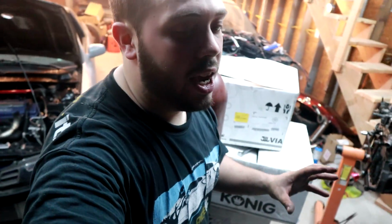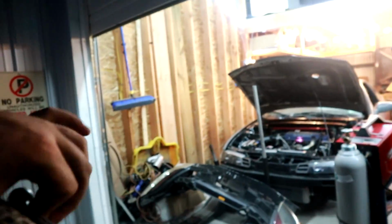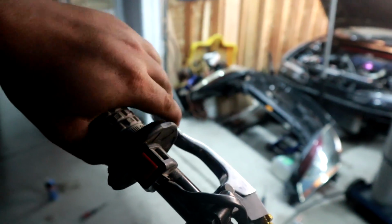Okay, so the levers don't fit my bike, but they may fit Callie's. But I did have an extra lever, which wasn't bent and broken, and I slid the perch over, and along with this, I got it all adjusted now, like the clutch. It's not the super easiest thing, it's not a hydro clutch by any means, but it is substantially easier than it was before.